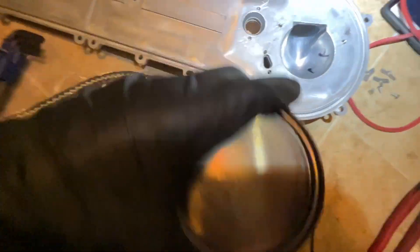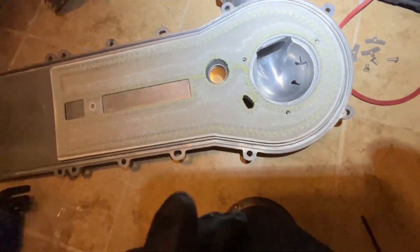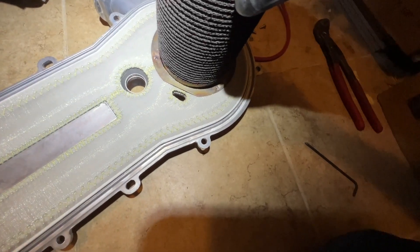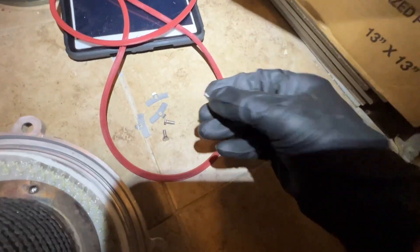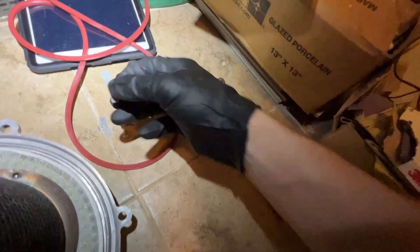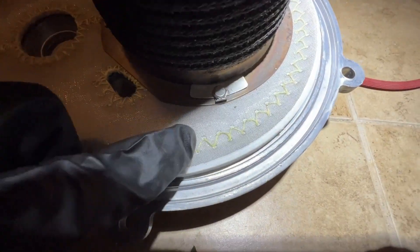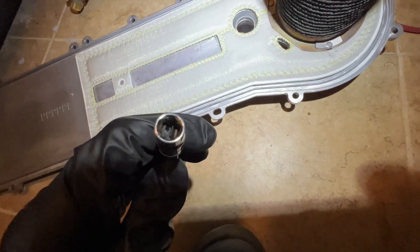For the mesh, this piece goes over and gets lined up so that the flat side is where the igniter is. It has these bolts with little locking flaps — you flip it up so it prevents it from unthreading — and those are bent up so they can't spin out at all. Tightened with a little nut driver extension; it's a nine thirty-seconds, super tiny, and kind of difficult to get in because it's a little bit thick.